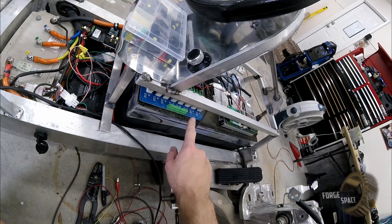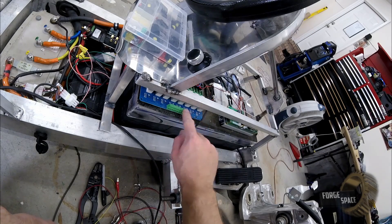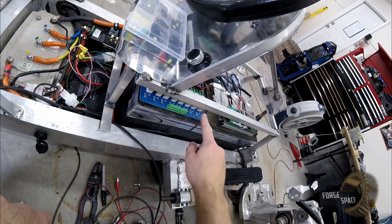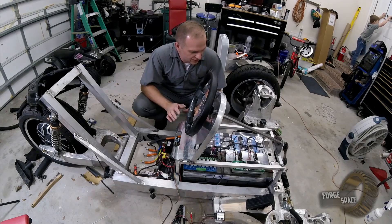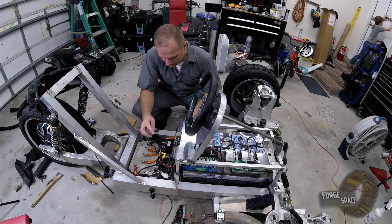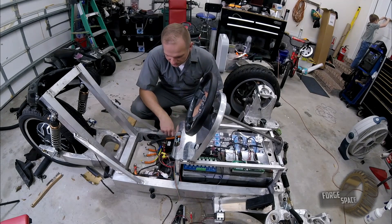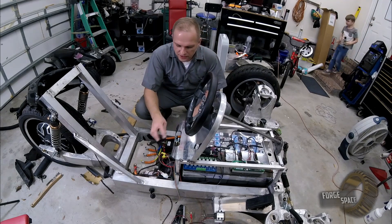So next, right here we have our solid state relay board. We're going to wire in our left turn signal, right turn signal, brake light, and parking lights off of this board so it's all controlled from a single point. Then we're going to use an Arduino to control when these turn on and off. While we're at it doing some electrical stuff, we're going to lift the steering wheel up and off and then connect up our contactor relay permanently, so that when you flick the key it automatically bridges itself and I don't have to use those jumpers anymore. Then we'll start wiring in our lights and everything.